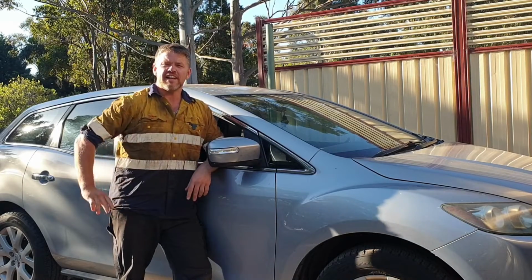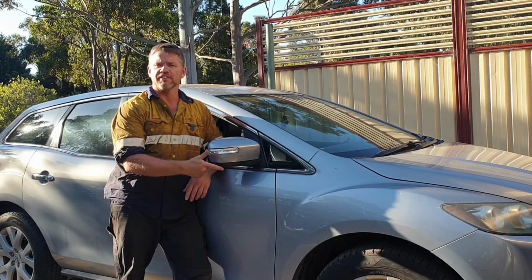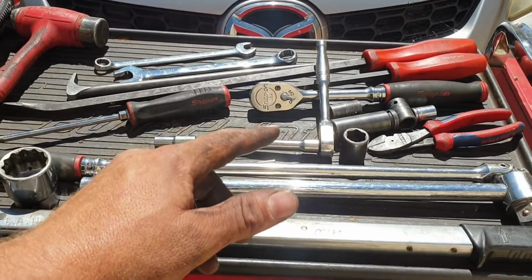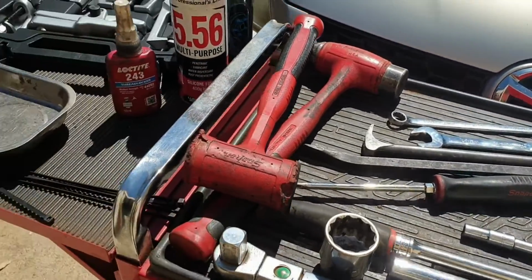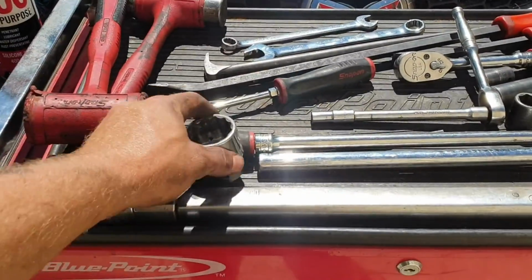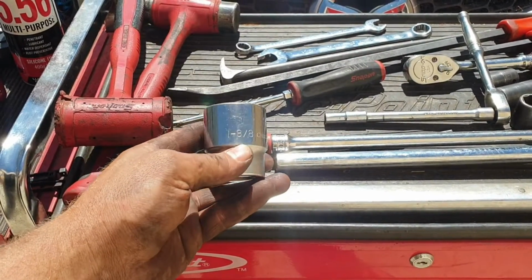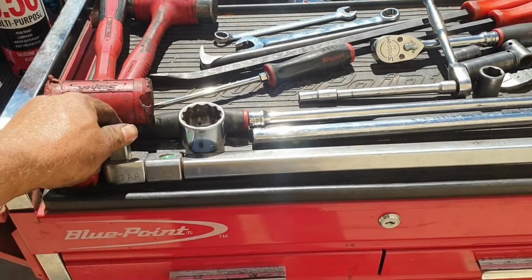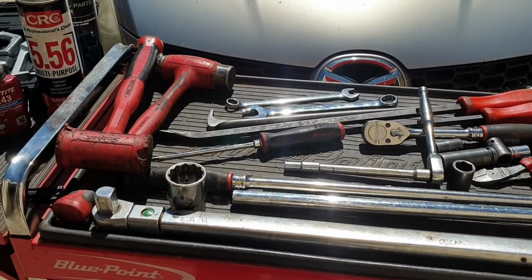G'day! Today down the shed, working on the Mazda CX7, changing out the front wheel bearing. Tools for the job. You can get away with some basic spanners, sockets, bits and pieces, pry bars, hammers, a few consumables. But the main thing to worry about is a socket to undo that drive shaft nut, either 35mm socket or 1 3/8, a torque wrench, but I'll put a list of the tools I used in the description.